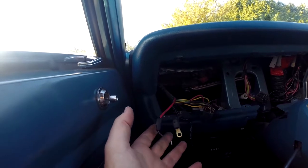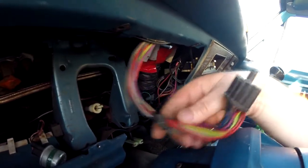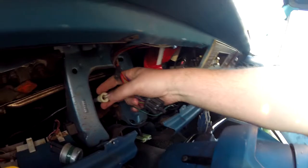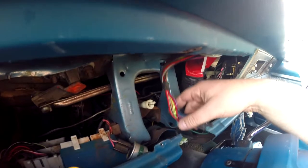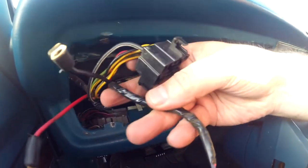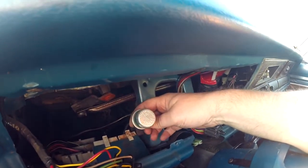I might not put it back exactly the way it was, because even if I find whatever's going on here, these wires might still be an issue in the future. This is one of the main gauge cluster wire bundles - these were the plugs that were really hard to get out when the dash couldn't come out very far. You have to remove the speedometer cable first before getting the dash off. Here's another bundle, but none of these I'm seeing right now are noticeably burnt, considering what I was smelling. I should probably pull the tape off and make sure it's done well. This looks like it's the blinker solenoid - and what do you know, made in the USA.